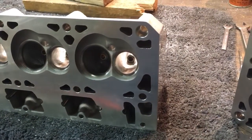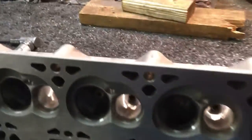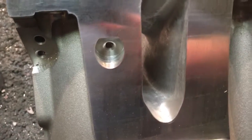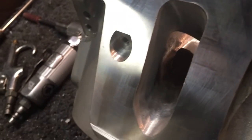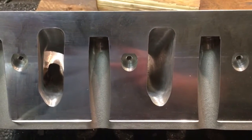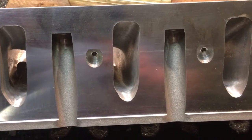I haven't cleaned up the rough casting on that back side yet. If I roll this head over you can see where I've been cleaning up down inside these intake ports. I wish I'd shown a better representation of just the casting lines that were running down each side of the port — I've been working to get those smoothed out without adding a whole lot of volume to the port. I haven't really worked the guide very much.